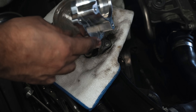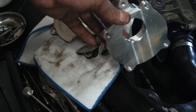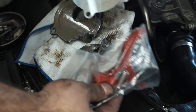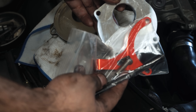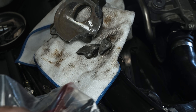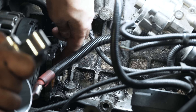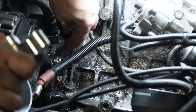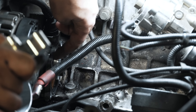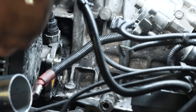That's why they now include this billet plate. You have this made out of billet — it comes with your overdrive kit now, so you don't have to worry about this problem. For people that were just installing this upgraded plate, the next thing to go was their vacuum housing itself, and that's why they made the support bracket to completely fix the issue. Once you replace these two parts, if you buy one of these Spool overdrive kits new, it'll come with this hardware. I'm ready to install the billet plate now. I was trying to get my hands on the o-ring that goes on the vacuum housing, but it wasn't available — you have to buy the whole vacuum housing if you want that. But you can find it on Amazon as an aftermarket solution, so I'd recommend you guys do that if you are retrofitting this plate after the fact.